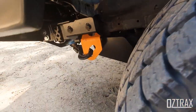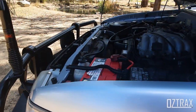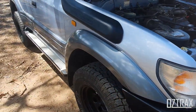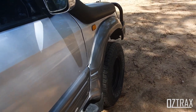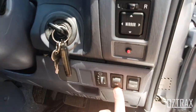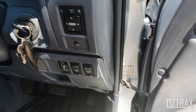All works now. I've also changed the switch. Unfortunately I've had to mount the excess wiring under here, but I'm going to change that. When I originally did these lights, the harness that came with them wasn't very long, so I couldn't get the switch to where I wanted it. But the new harness has fixed that problem, so I now have my driving lights on the bull bar, and here is my spotlight switch — that fixes that issue.